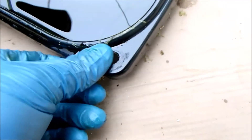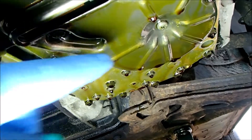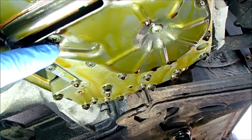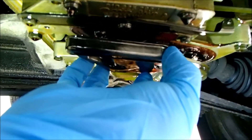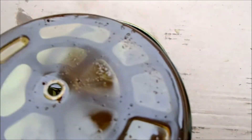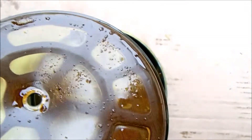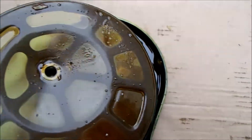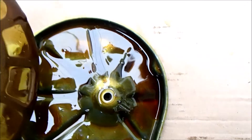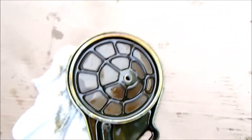There's a lot of silicone sealant on the old pan and I'm hoping it was just a precautionary measure by the last owner. I'm going to clean this up with brake cleaner. I've cracked off the two screws here — make sure you get the right fitting screwdriver and gently wiggle them out; you don't want to snap them off. This is the filter, and you can definitely see some bits of rubbish in there. The kit I bought came with a gasket set and replacement filter, so I'll just replace it. We'll clean out any lumps and bumps with brake cleaner.